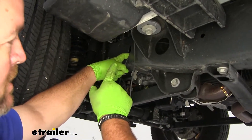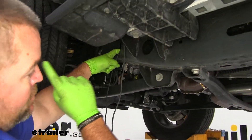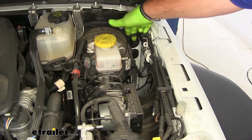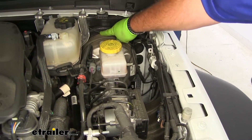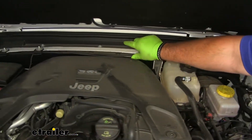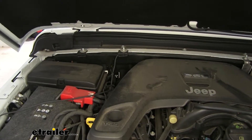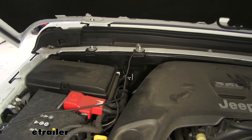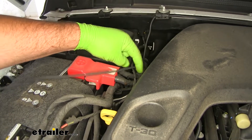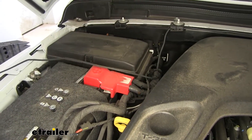Using the airline tube pushed up through the large hole at the front, pull the wire up, then run it across — the battery is on the passenger side. My wire came up at the back of the engine bay, went around the brake booster, fed it behind two brackets, went right across the firewall, went behind the first bracket, and tied it to the factory wiring here to keep it tight.